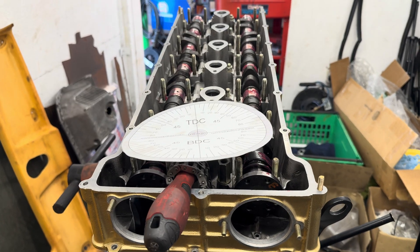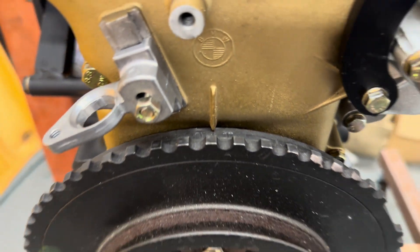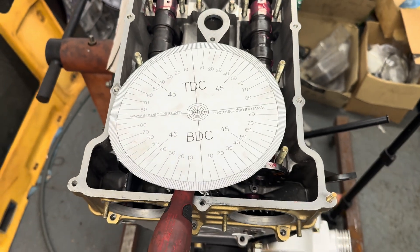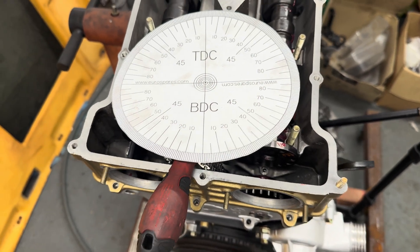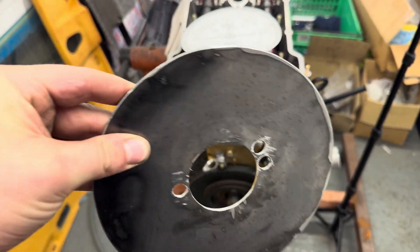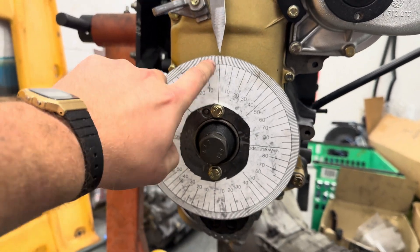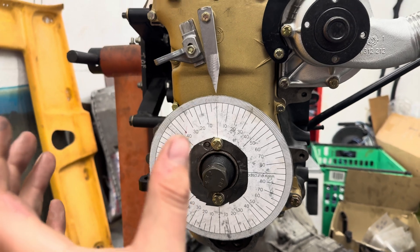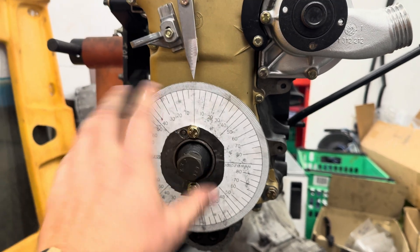Before I put all the rest of the buckets and shims in — because the valves have been moved around — I've had to line this up with top dead center. I'm going to fit this little indexing piece so I can measure away from top dead center, just to allow the valves to seat correctly. I've made a little angle gauge with an arrow to show where it's at, using the original TDC mark as reference.